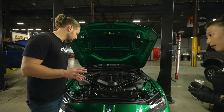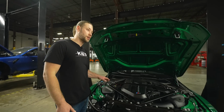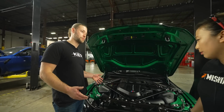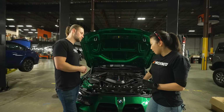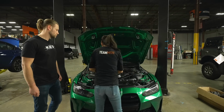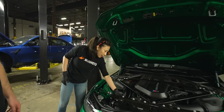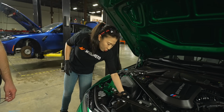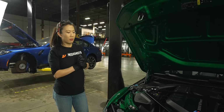So you said earlier that this is with the B58 engine, that there were a lot of similarities, which really helped. Yeah, it does really help. It is similar, but it's also different. What we were able to reuse is a CNC adapter on the driver's side turbo snout. So on the driver's side turbo snout, this is a black plastic piece that goes into the turbo.